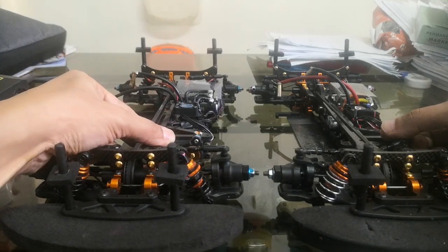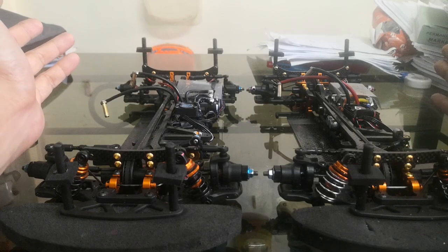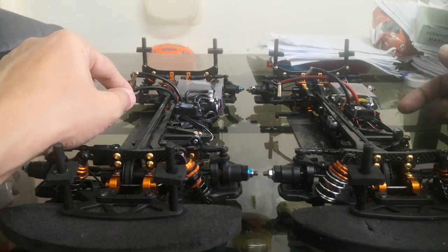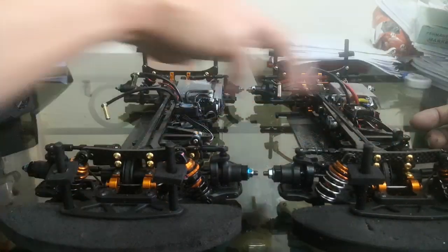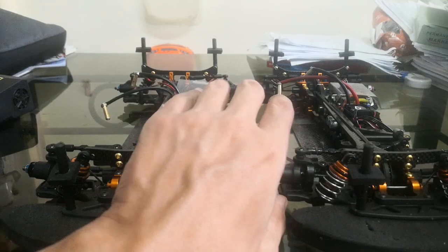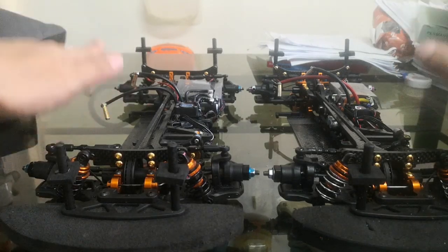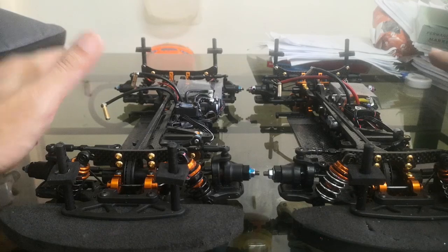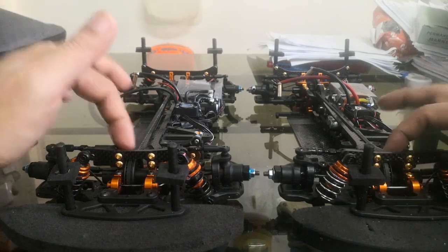There's a lot of tuning with spacers as well. I use the longest camber links for stability and less camber change — I like things to move a little less. I don't like a lot of camber movement, I don't like a lot of bump steer. I try to set everything up with minimal changes as the suspension compresses, to keep the cars stable.